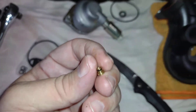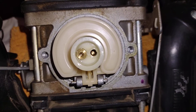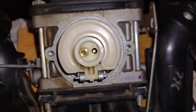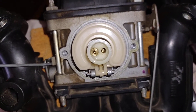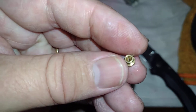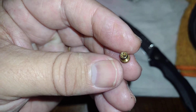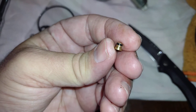My eyes aren't the best, but I only took one out again. Do not take both out. You replace the gasket on one side, put it back in, and then work on the other side. I don't mean to be harsh, but you need to listen to me on this — it's very important. The inside diameter is just a hair different and there's no way I could tell.